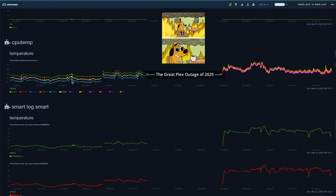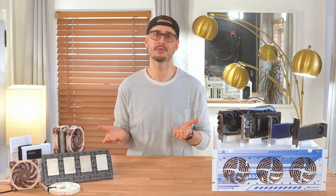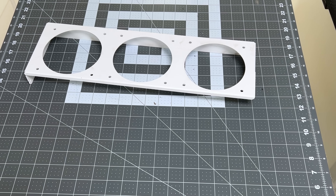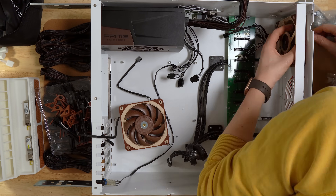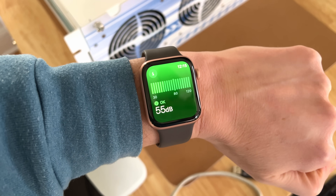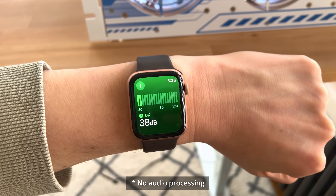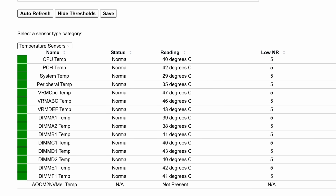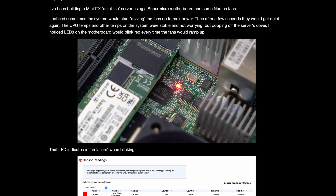Temperatures went from an average of 32°C to 36°C across 24 hours, with peaks in the low 50s — which makes sense given the jump from 85W to 150W TDP. The server used to run loud even at idle. I replaced all six case fans with Noctuas and wired them directly to the SuperMicro motherboard instead of the breakout board. That gave me full PWM control. Using the motherboard's optimal fan profile with a few tweaks, I dropped the noise from around 56 decibels to 38–40 decibels at idle, and about 46 under load. RPMs are now in the 400–700 range and it still cools just as well. One issue though — after installing all the fans, IPMI started flagging all six as running too slow. I followed the guide from Jeff Geerling to adjust IPMI thresholds, and that fixed it. Thanks, Jeff.